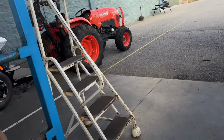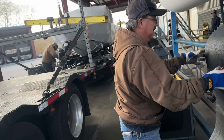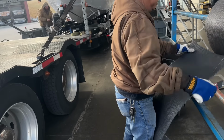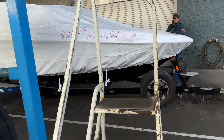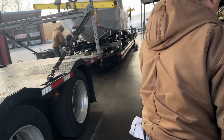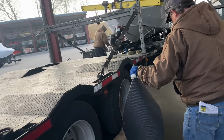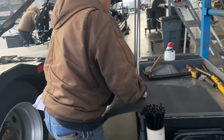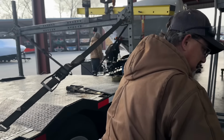Oh, you're going to turn it up? I'm going to put the same injectors the Cam Rooster's got in it. If I'm going to drive it, it's getting twin stacks, right, a visor. Right. A cam, injectors, and turbo. It's governor, what, 65? You know that. These things here run wide open. Sammy had them where they'd run. Hell, they got 308 gears with 13 speed. This one don't anymore. I switched this one to 342s with 13. It runs about 70, 75 pretty easy. Good RPM, about 1600.